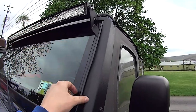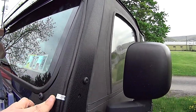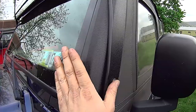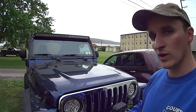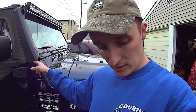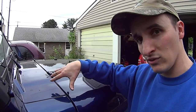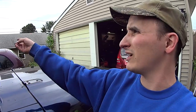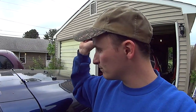Now the next step is figuring out wiring. Initially I was thinking I could run it under this bracket, but this bracket sits pretty well right up against the windshield frame. It might actually be easier to flip the light over and run the wire down this side. The snorkel might even be able to hide some of it if I can get it down and into this section here. The battery is on this side anyway — that's where I have the relay for my other light mounted. So it would make a lot more sense. I think we're going to flip this over. Then I need to get the snorkel on, so I need to drill.